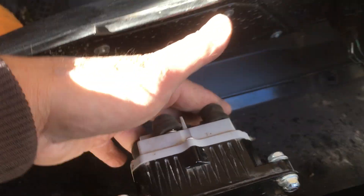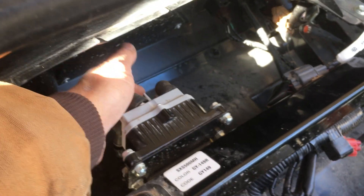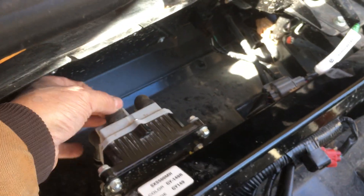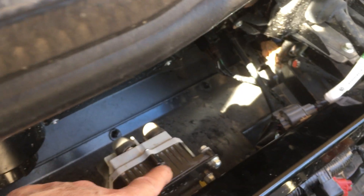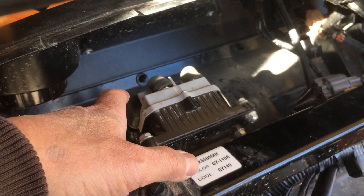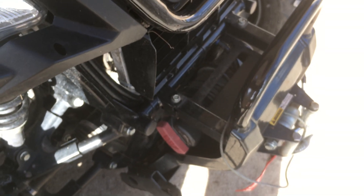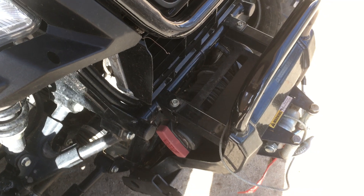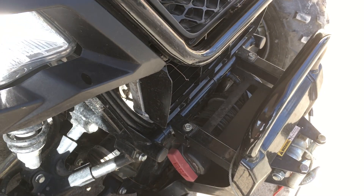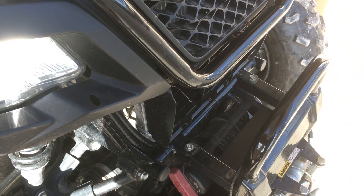You told me that when it shut down, it just went down slowly to drop the plow. I think what happened was excessive current for low voltage. This — I believe — is shot. This is the relay actuator. I feel really badly because I have two spares back at the house. The other thing I'm afraid of is that your winch is shot. I think that activity burned up the winch. The fact that you've got power to the winch and the winch doesn't work, that's a problem.